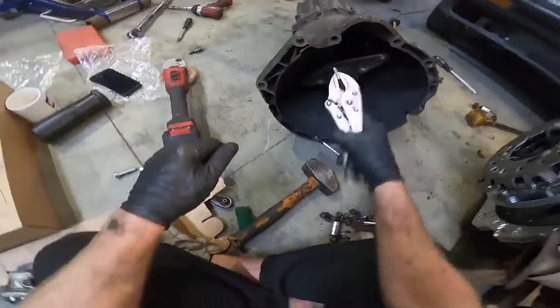After making and installing all my own fuel lines, it was time to give it a crank. The car wouldn't actually turn over using the key, so I went to the relays and jumped the starter relay to confirm the starter was working — and it was cranking. After about four sleepless nights of stress, we found the reason it wasn't starting on the key. Because this ECU came from an automatic car, it needs to know which gear the gearbox is in before allowing it to start — it needs to think it's in park or neutral. We plugged in a neutral safety switch, spun it to park, and it started.